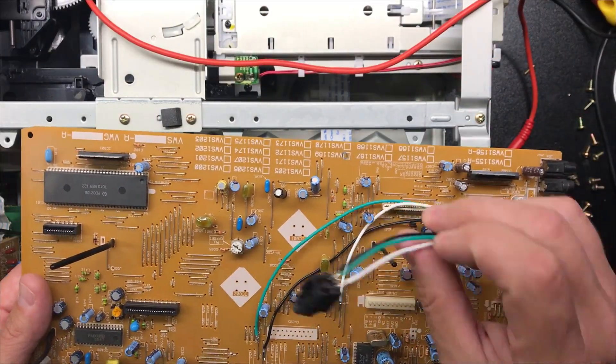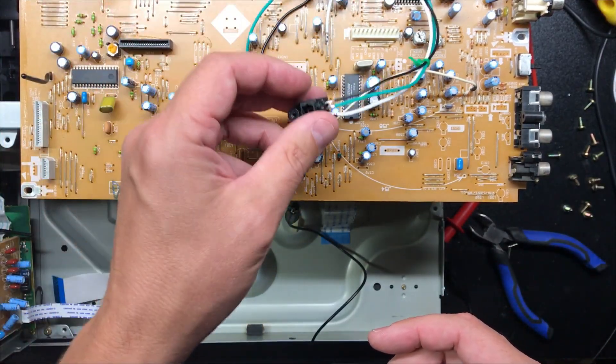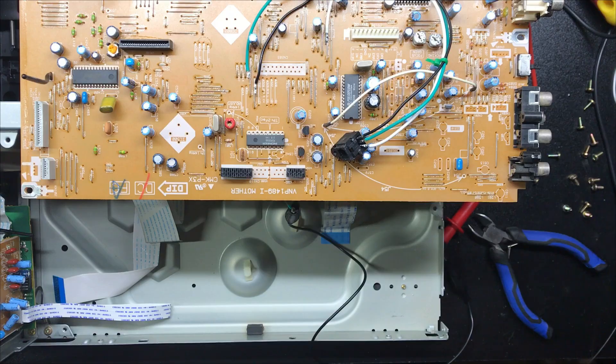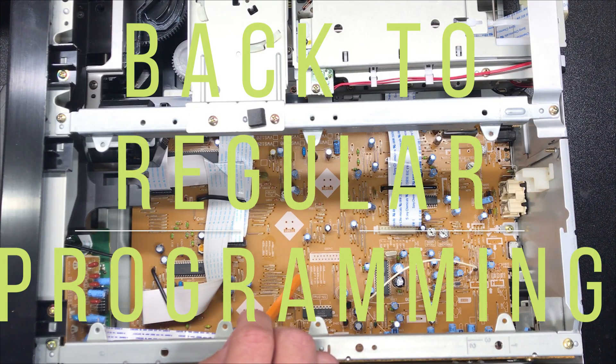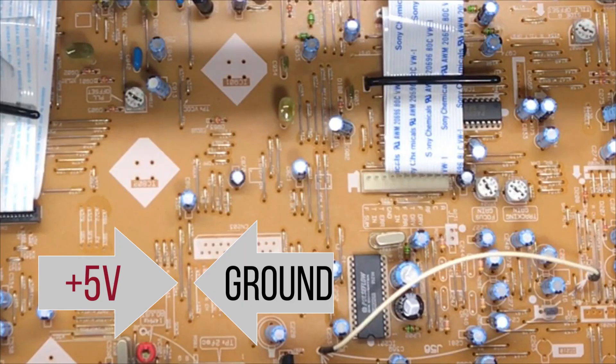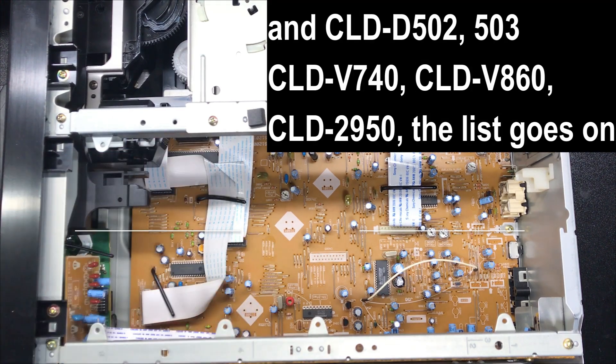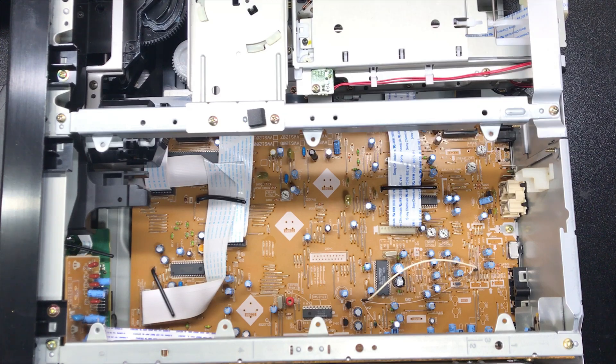Snake the cable back around and connect it to your TOSLINK adapter — whatever they call it nowadays — and then you're in business. We've got positive 5 volts right here and our ground connection. For anybody with a CLD-V5000 industrial model: exact same board, exact same tap points, in case you want to add a digital out on that.